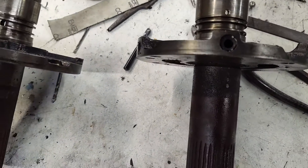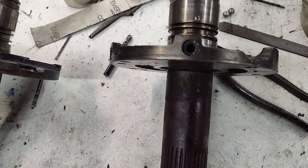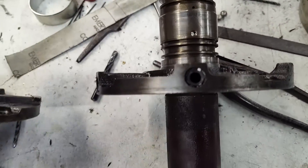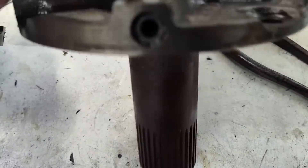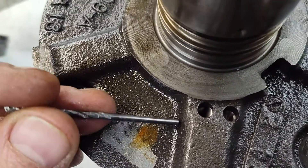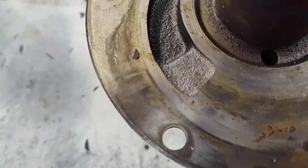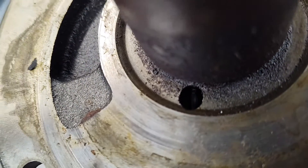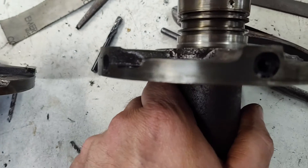Jay Browder Performance again. Another thing I want to show you on these, and this is something you got to be careful with. So what we got here — if you see this little retainer, it's got a spring inside, and if you look in these two holes there's a valve in there. There's a little pin in here, and anyways, this is the converter pressure relief valve.